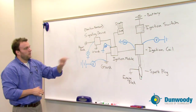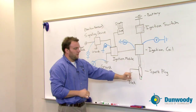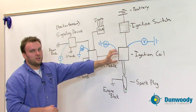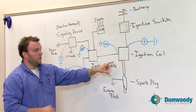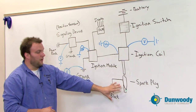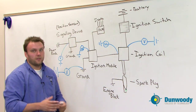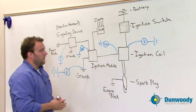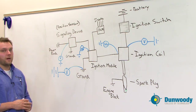Another important point is that the only maintenance-type item on the system is the spark plug. If the gap gets too large and that spark is working hard, it puts stress on the rest of the system, namely the ignition coil. Remember from our first video series that this coil needs to be able to put out 40,000 plus volts. Generally we only need maybe 10 to 15 thousand volts here, but as that gap widens and degrades, it might need 40,000 volts, and at some point the ignition coil might not be able to produce that on a regular basis. That's why we need to replace plugs at a specified maintenance interval based on the manufacturer's recommendations.